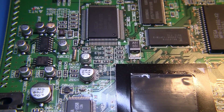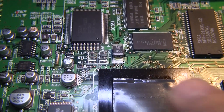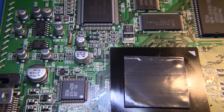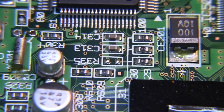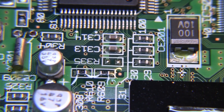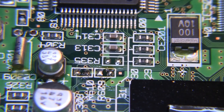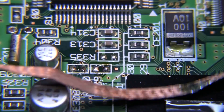Here we're back on a motherboard view — this is the top side of the motherboard. Here's the power port right here. We're going to be focusing on this chip right here and this chip. This is the video DAC jack and this is the audio IC. The first thing we need to do is remove these two resistors right here. Let's drop a little bit of flux on. Then I'm going to heat up both sides of my iron and just drag them away. I'm going to clean up those spots because that needs to be flat. You can discard those resistors.